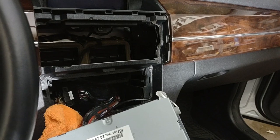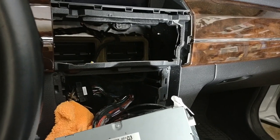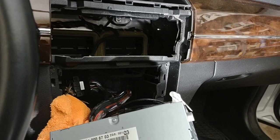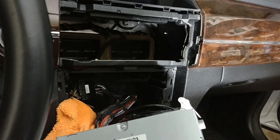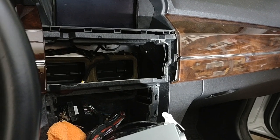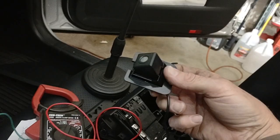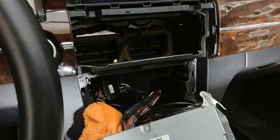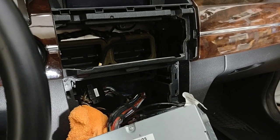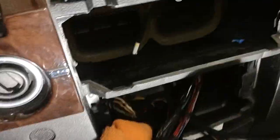Part of this test involves hooking it up to the actual wiring points. The camera is easy; power is a little more complicated. The standard logic is you hook it up to your reverse light circuit so that when you go to reverse, the camera powers up. I'm not going to do that — I don't really want to run extra wiring down inside the back corner to the lighting circuit. The camera draws almost no current at all. So I just want to find a switched power source. After a lot of sleuthing online, I've found a wire I can use here.